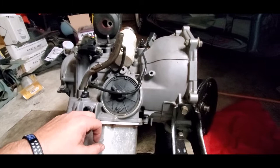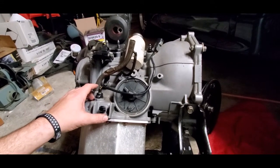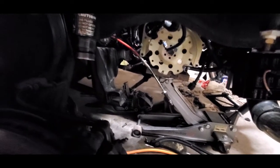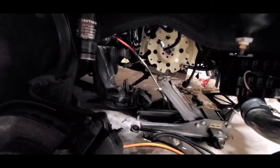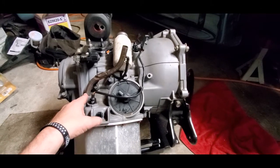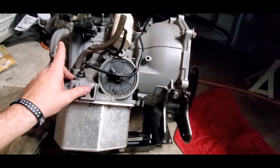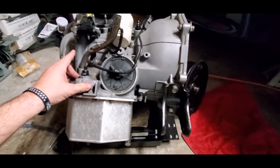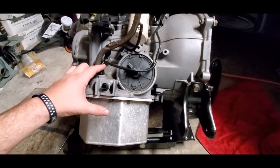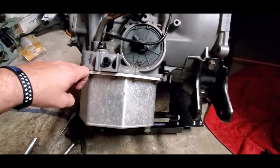Anyway, I hope that helps. I know a lot of this information is on forums or Facebook groups, but I wanted to get it all in one location as a video. This is a 2G transmission, and I think some first-gen guys who go with the second-gen transmission can use it as well — a second gen will go in a first gen, but a first gen won't go in a second gen. Inside the transmission I have a welded center diff, an upgraded Kegley six-pack clutch disc, and an upgraded shift kit with upgraded springs — a ported valve body.